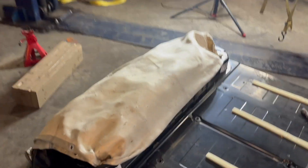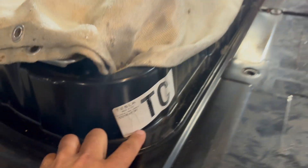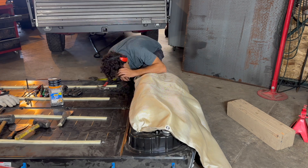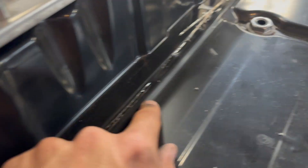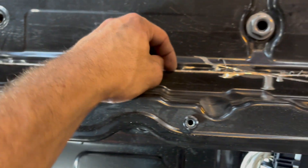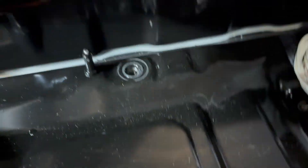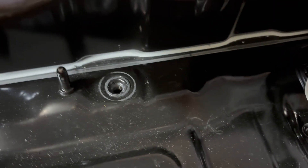One thing to get the penthouse totally removed: you need to cut this laser weld. It has been laser welded from the factory and is also epoxied on. So you have to go through, cut this laser weld, chisel it out, and then use a scraper to pull this off. About an hour later, we've gone around and hit this with an angle grinder and came through with a putty knife and screwdriver combo to get it all up. There's a very thin lip and epoxy along the edge — they glue it on and then laser weld it.